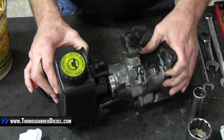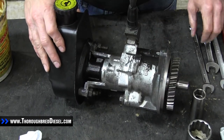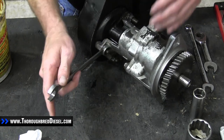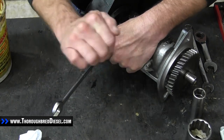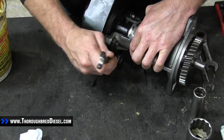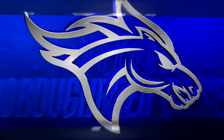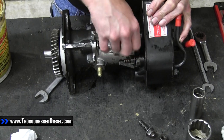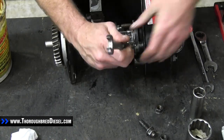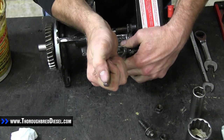We've already put a new hydraulic pump, a new power steering pump on this — it was a cheap and easy part to fix. So we're going to show you how to take the power steering pump off. Use a 15mm metric wrench for these and just go ahead and start loosening these nuts up. There are four of them which attach it to the vacuum pump. When you're working with this pump, you really want to be careful. The vacuum pump is a very expensive part. If you bust the housing, all bets are off — you will have to get a new vacuum pump.